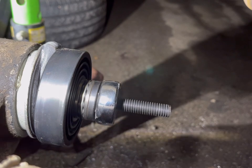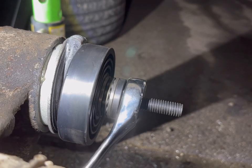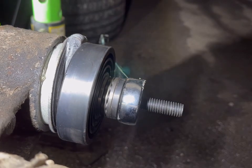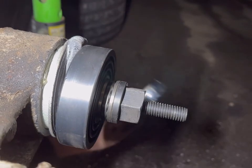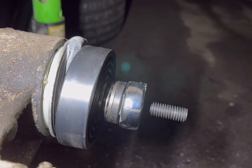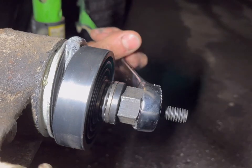I'm going to take this back off, see what's happening with the bearing, and cut back in when I'm back doing it. Alright guys, we're back in. As you can see, it is being a bit of a pig — it is squashing this bush because it's got a metal end to it, but yeah, it's not the easiest of tasks to do. You can see it is definitely going in, but it's squashing that bush quite profusely unfortunately. We're very nearly there.